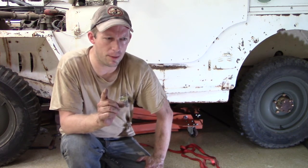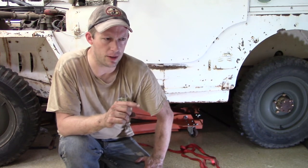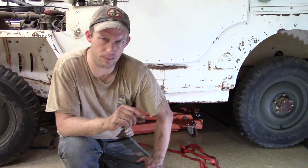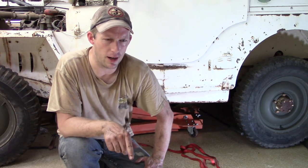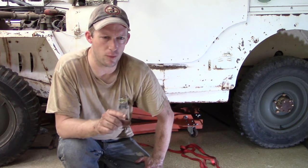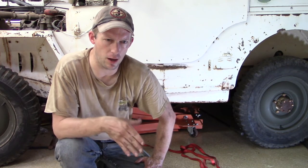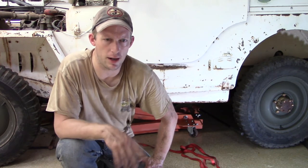One at the very top on the passenger side, and then as you work down, a couple near the starter, one on that part where it connects to the block, and then down below. And then again on the driver's side, there's the one up on the top, and then one as you work down, one that connects to the block where that little ear comes out, and then another one on the bottom. So we have all of those tightened up now. Let's get to it.